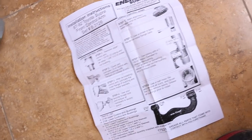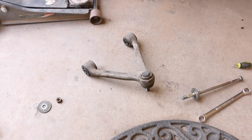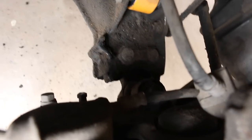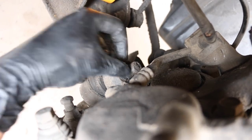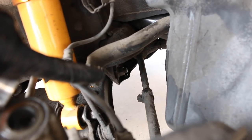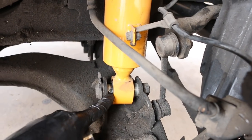With your bushing kit you'll get a guide of which bushing goes where. I'm just gonna take both upper control arms to a machine shop and get the upper ones done. Same thing with the bottom knuckle for the lower control arm - once again you have to provide some pressure to prevent the bolt from spinning, then you're able to remove the nut. To remove the lower control arm you're gonna have to remove the coilover shock bolts right here.